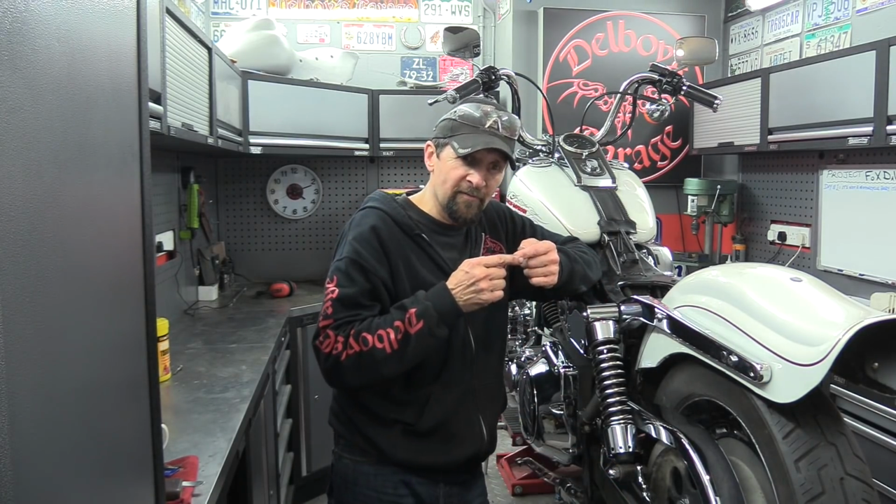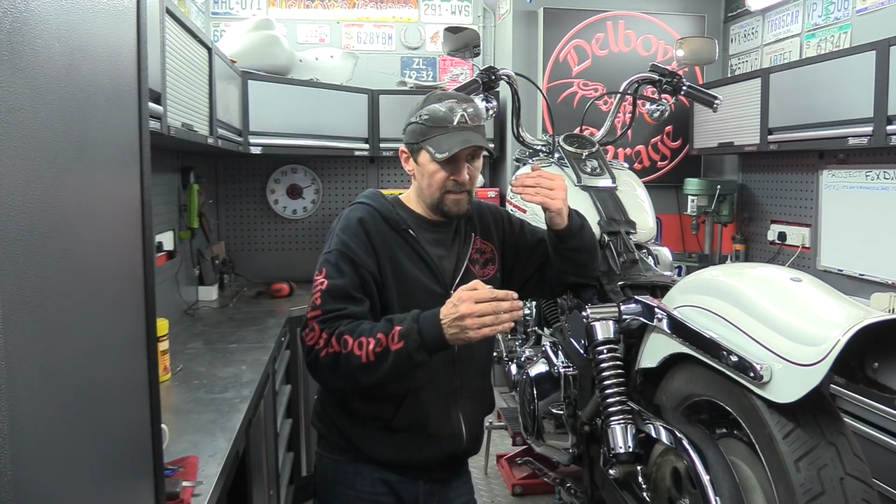So I was going to put some Burley slammer shocks on it and drop it down about 1.5 inches, but I may have to find another way to do it. One way to do it is the little metal lowering blocks you can buy. They fit into the rear shock mount and they put it further back by a given amount, and that lays the shock down a bit, which effectively lowers the rear.